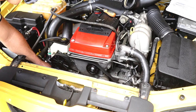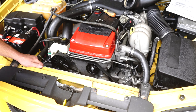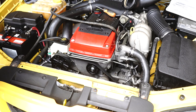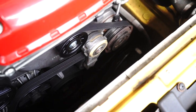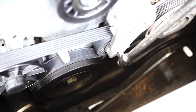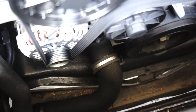You can see this fan belt actually still has quite a lot of tension on it — unless of course you've suffered pulley failure. In order to release that pressure, there is a special tensioner pulley located right here at the front of the engine. All you actually need is a 3/8 drive wrench — you should be able to access that area and slot your 3/8 drive into that zone.